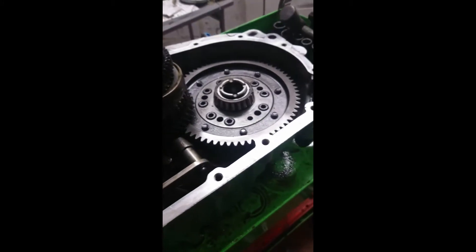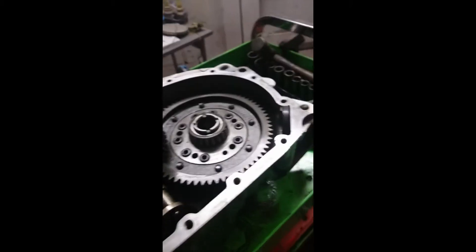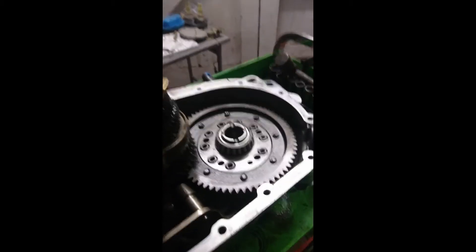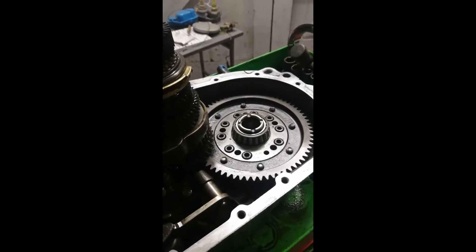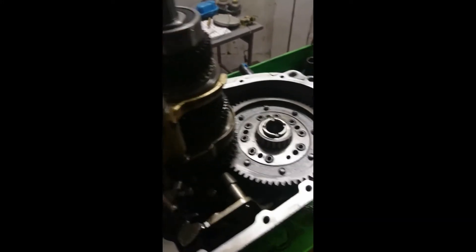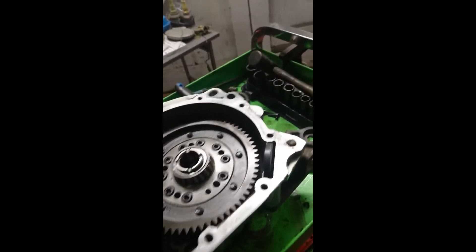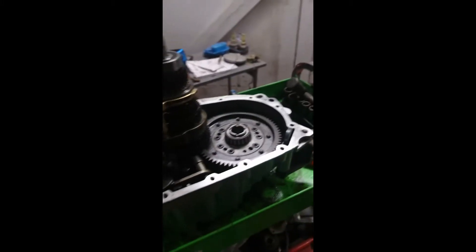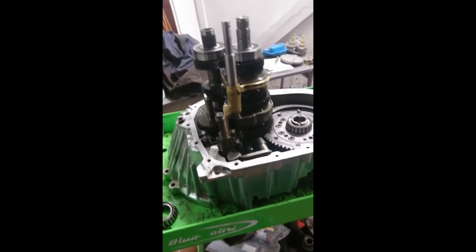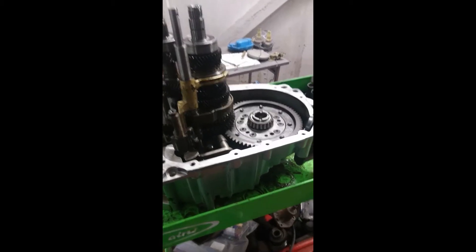The box I've currently got built is a 1.7 gear set with a 1.7 final drive — Series 2 RS Turbo — with a limited slip diff, but with a 1.6 fifth gear. That makes it run much nicer at motorway cruising speeds. But for what I do, I don't need it, and it was a nightmare when I was doing road rallies, because you'd be running in fourth and then there was such a big difference between fourth and fifth. My leg was sore from changing up and down the gears by the end of the night. But it is nice for running on motorways if you ever want to do it.